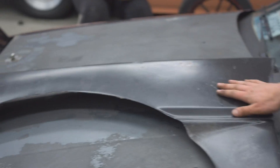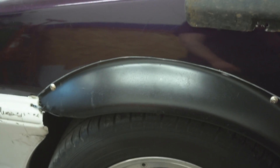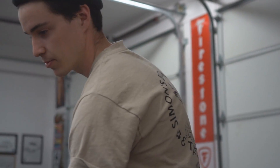Another thing that's been really bothering me is the fenders. What I did was grab my old metal fenders that came on the car, and cut the flare off the fiberglass ones and mounted it to the metal ones. The reason is the original ones are all messed up - these weren't nice fenders so that's why I never ran them. The fiberglass ones never fit very well either, so this is probably a temporary thing, but the body lines match up way better and it's purple all the way across the car now.